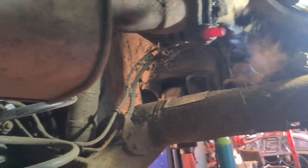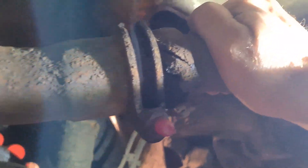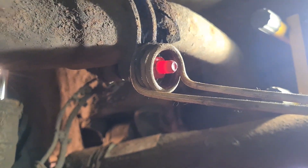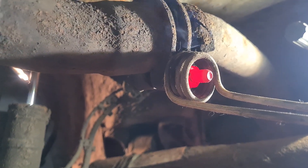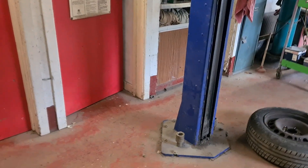Get the wire brush and knock the crap off — best to wear gloves, but I'm not because I'm silly. As you can see, that's glowing red and the surrounding material is stone cold — it's a stone cold type of clamp. If you were doing that with oxy, you would not be able to do that. Get it nice and hot again — you can see it's already cleaned the threads off. It's nice and hot. I dropped it by accident but it was okay because it was hanging on my shoulder, so it didn't damage anything. Getting my ratchet out of my pocket.